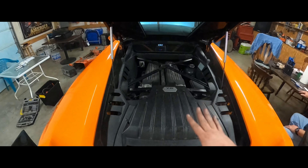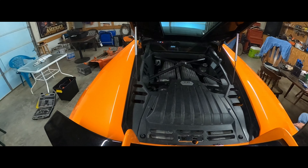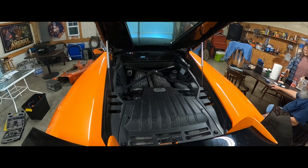Get ready to fire this bad boy up. We've got everything back — new coil packs in there, new spark plugs in there, everything put back into place: all the carbon fiber, all the struts and everything else. Nothing left to do but close this back end up and fire this thing up.